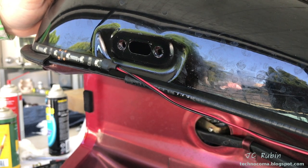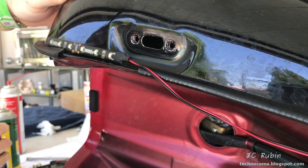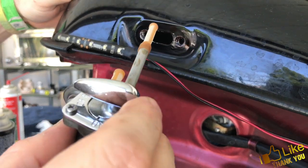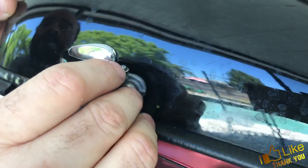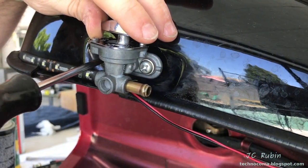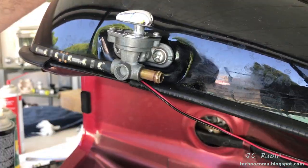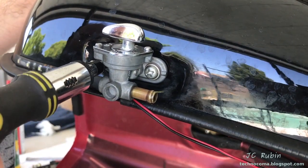This brings us to the bottom of the tank, and we will now put the shutoff valve back on. First we'll clean the mating surface — we'll have some spray cleaner here, some detergent. We insert the valve. Get each side just snug, and then give each side a tighten.